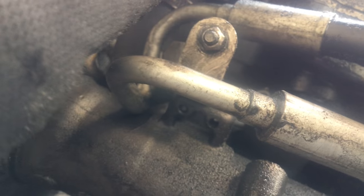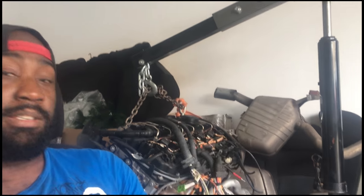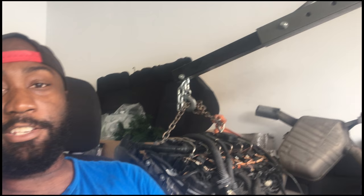Next I need to go ahead and take off these power steering lines and disconnect them from the body of the car. Right here is a 10mm and over here is a 10mm also. The only thing I have left to do now is drain out the fluid and then disconnect the hoses from the steering rack, the power steering pump, and all that. Then loosen the engine mounts, take the engine off the engine mount, put it on that tire, hook it up to the engine hoist, and then pull it out.